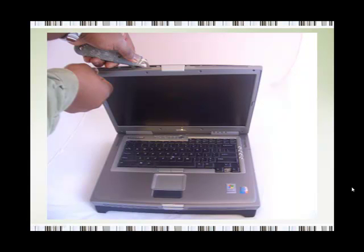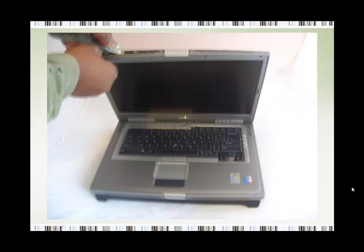as if you are making a surgical incision. Now, obviously, if you own a pristine Sony Vaio, then you definitely will want to be very careful in prizing away the bezel from your laptop. Now, you may have to twist the knife a little bit, but just be careful not to twist it too much. You want to prise away the bezel from the back panel, and like I said, do not press too hard with a knife. In fact, the knife is just to start the process off.